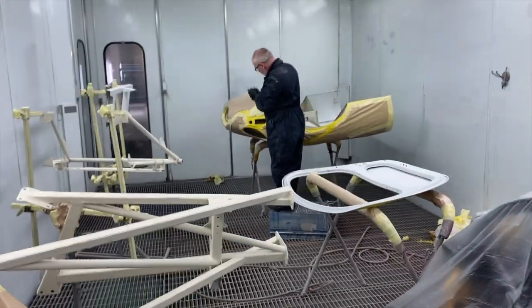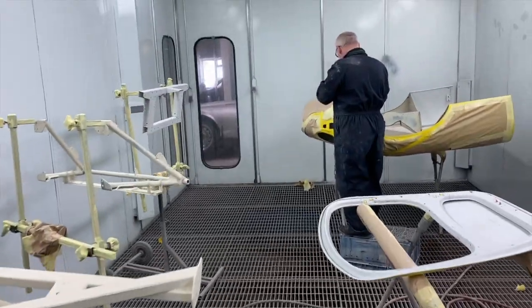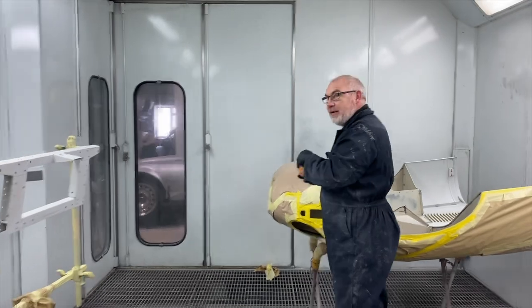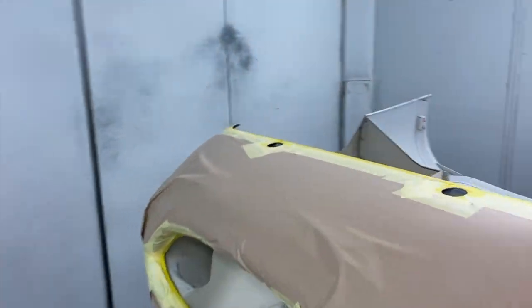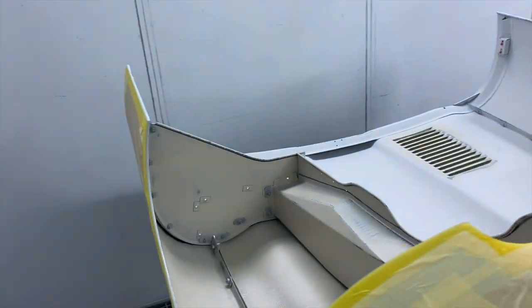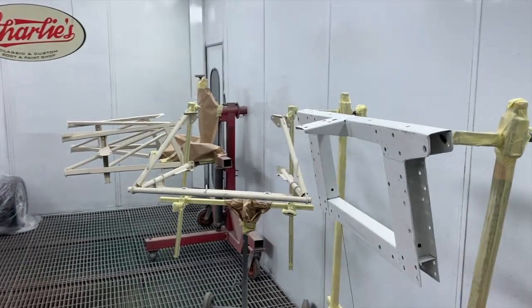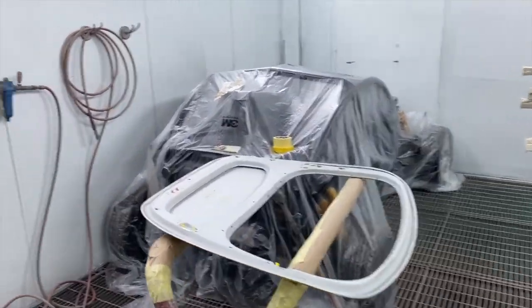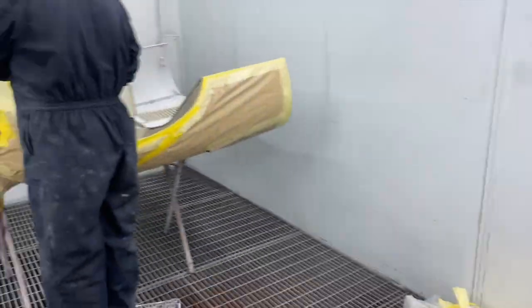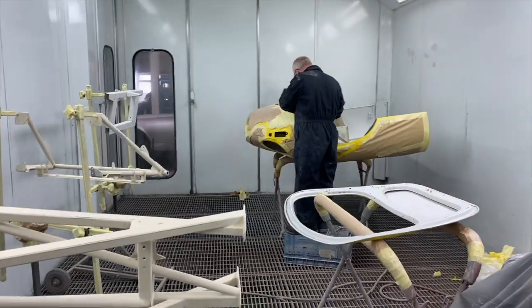Update on the E-Type Jonny Long door 2+2 greenhouse clown shoe limousine. AD's in the booth. Hello. And he's masked up the bonnet so we can do the underside. We've put some stone chip in the arches and then demasked it so we can paint the whole thing. The front framework is here, picture frame, front frame, side frames. The boot lid is in here, and it's pretty much ready for us to slap on some direct gloss. So I'm gonna do that now.